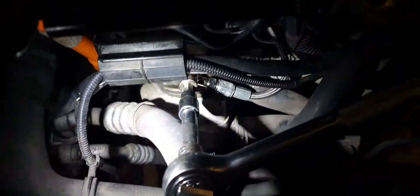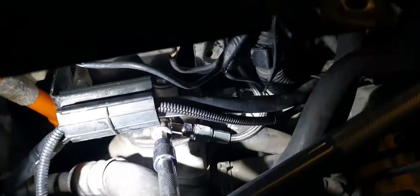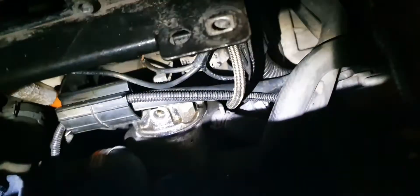I'm thinking about keeping it because it's actually some good Nulon oil that I'm using, and I've got to drop the coolant again. I've got heaps of coolant. I'm gonna try and catch the oil if I can. There's no way for me to fix this unfortunately. It's not just the oil cooler — if it was then it'd be an easy fix, but it's actually the whole unit that connects up to the PCV. So I'll have to take all this stuff out. Biggest pain in the bum.